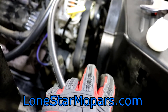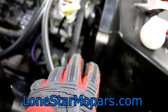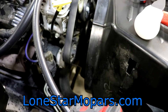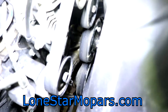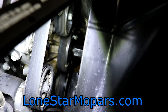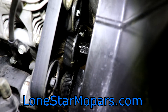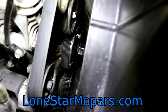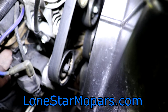You might think, why is the serpentine belt still on? I leave it there for tension — if you take it off, everything will free-spin. Since I'm replacing the belt and the pulleys anyway, no harm done. What's critically important: look down in there and you'll see a bolt head coming in at a funky angle, right above the fan clutch nut. That is a 5/16 bolt. I ran inch-and-a-half at first, had two of them, but they're gone now. I then tried some 3/8s.